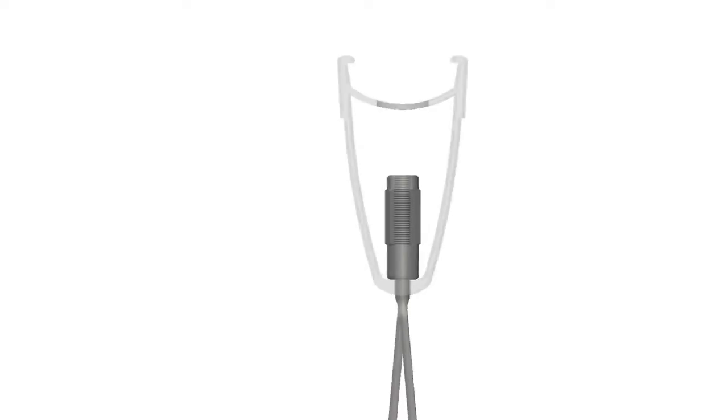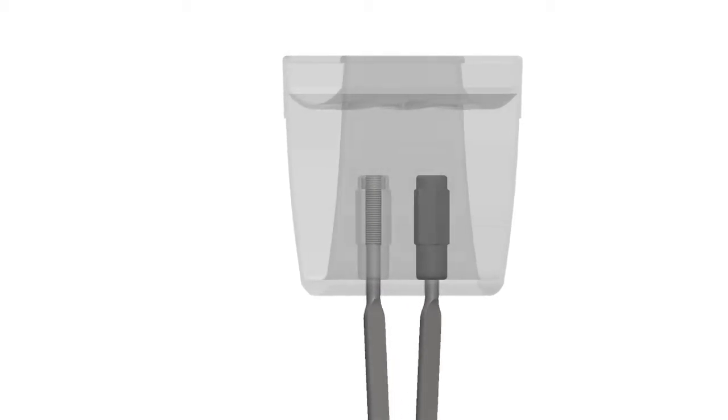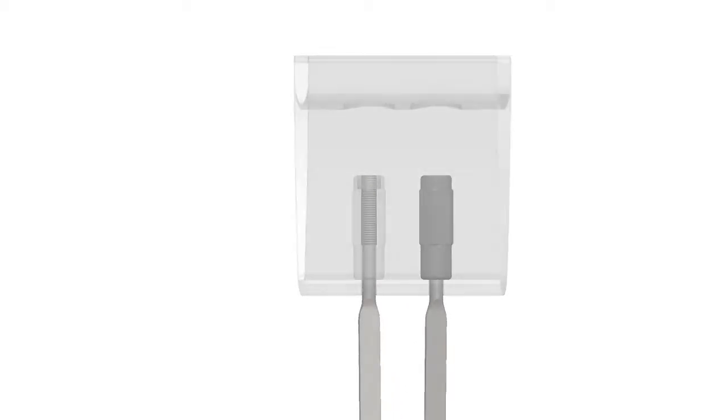The internal nipples get you away from the tension issue. They put the entire nipple in compression. So under the spoke tension our entire nipple is in compression, which means it's not subject to fatigue loading.